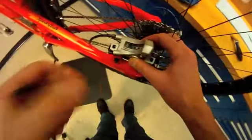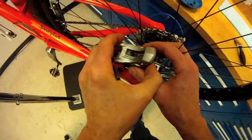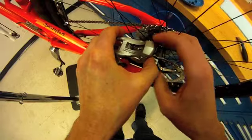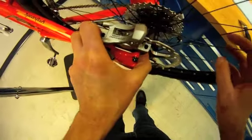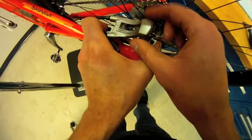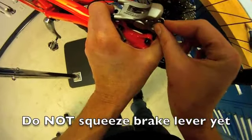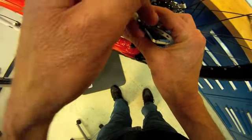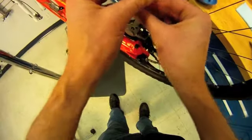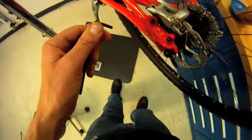In a perfect world, they would travel the same on both sides, so it would make sense to skip this technique. But because they've now traveled in what is natural for this caliper, we're going to bolt this down and adjust to how the pistons naturally like to sit. There can be small asperities on the cylinders inside, and this will account for that.